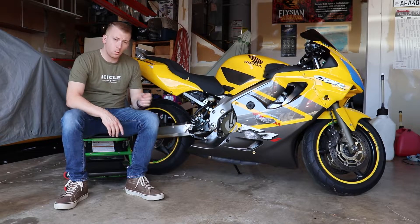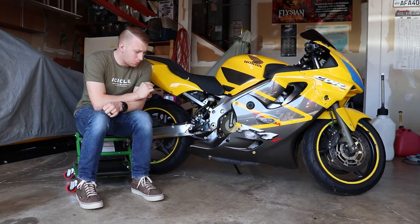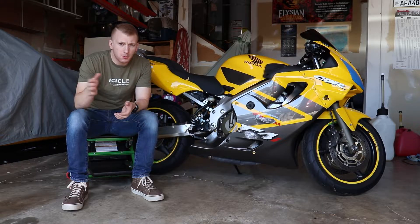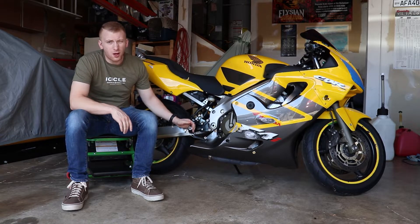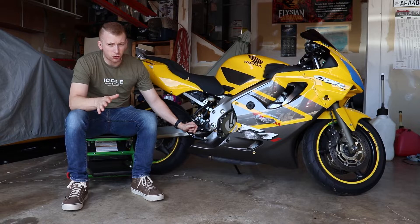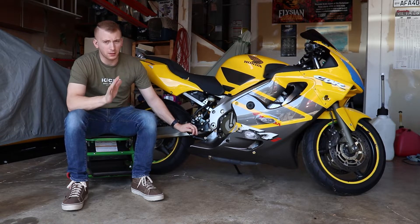The Woodcrafts are way too expensive; I think I got these for about a hundred dollars and they've worked fine, so I would get them again. One note: if you use these particular Chinese rear sets — I'll try to find them on eBay and put them in the description — use red Loctite. They have fallen apart on me while riding casually, but ever since I used Loctite and torqued down the bolts, they did great.